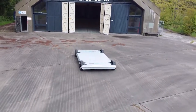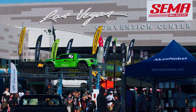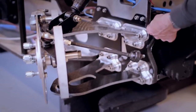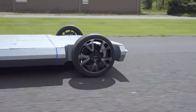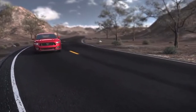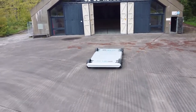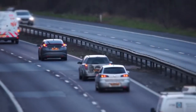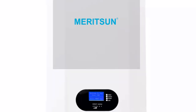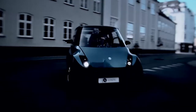For example, a corporation called Protean Electric unveiled a Ford F-150 truck at the Specialty Equipment Market Association exhibit in 2008. The company revised the Ford F-150 EV by eliminating the V8 engine and adding four in-wheel electric motors to the truck. These four Protean Drive motors are capable of delivering over 100 HP each, equaling 400 HP from all four motors — far more than generated by the standard V8 engine. Each motor weighed just 68 pounds (31 kilograms).